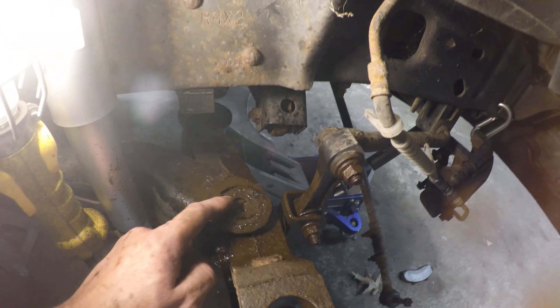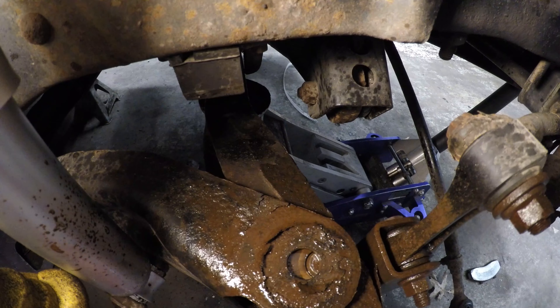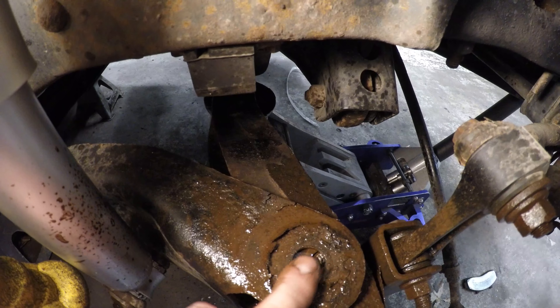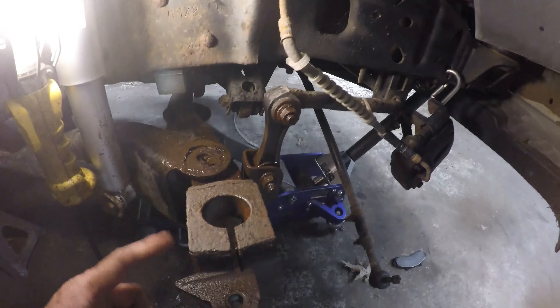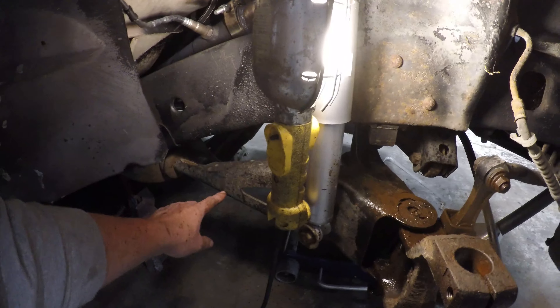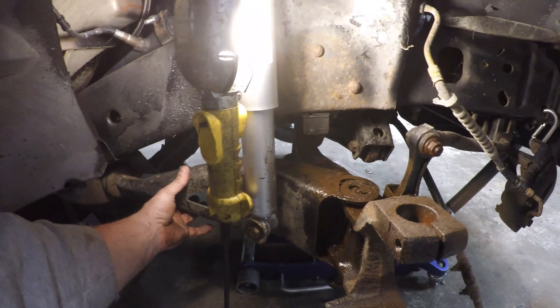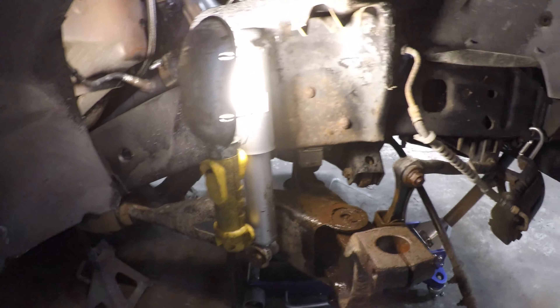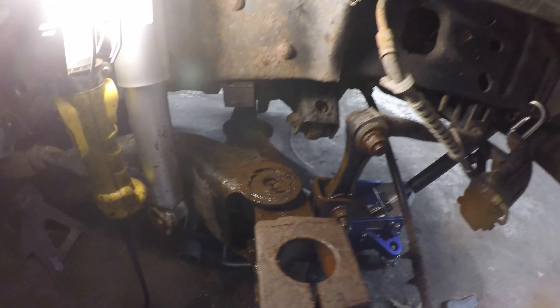So one thing I noticed when that bolt came through — this hole is off center. So there's tension on this hole; the bolt actually threaded out of it and then the whole arm moved, and you can see how it's off center — the bolt can't necessarily come up through this hole. There's tension on this arm, and I'm also putting tension on it with the jack. I could probably loosen up this trailing arm back here and take some of the stiffness out — that bushing's tight and it's putting tension on it. So I'll probably have to loosen this up and that should give me a little wiggle room, and the bolt should fall right out.